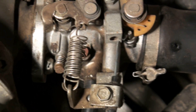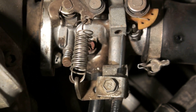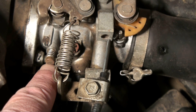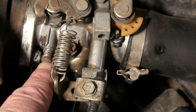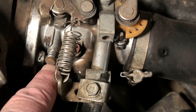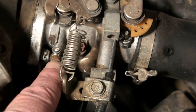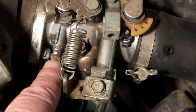It's kind of tricky to set this. You have to take the engine and slow it down to its slowest speed that you can possibly get it to run and stay running steady. Once you get it running slow — maybe by blocking up the pedal or having somebody hold it — you're going to adjust this out and it'll start to run rich. Then you turn it back in until it runs lean, and back it out to the happy medium.